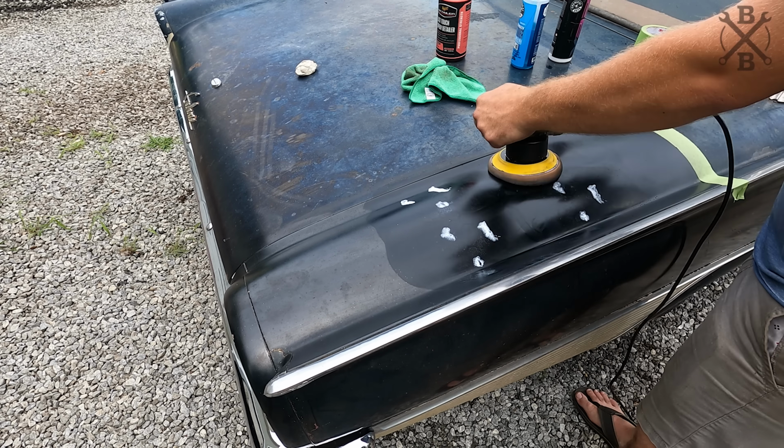I want to keep it wet, really nice and wet. Let's very gently sand it until we get rid of all the little dimples and we really see a nice, smooth, dull surface. I want to move to a 2000 to clean it up, and then we'll finish it off with a 3000 that'll really get 98% of those scuff marks out of there. And then we'll compound it again and let's see the difference.